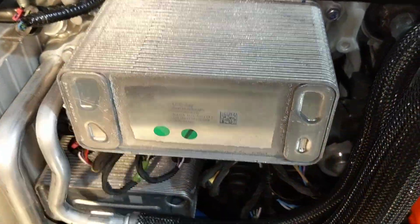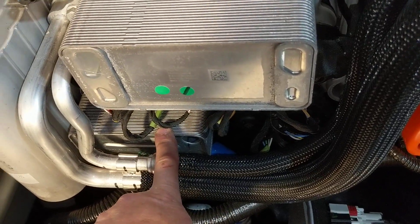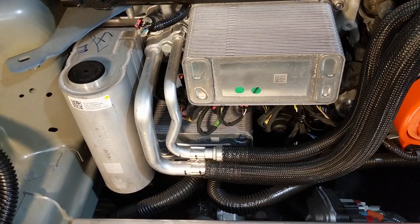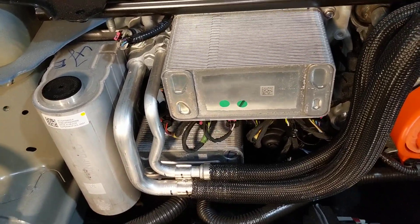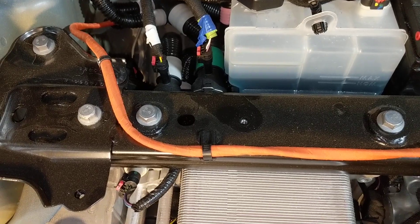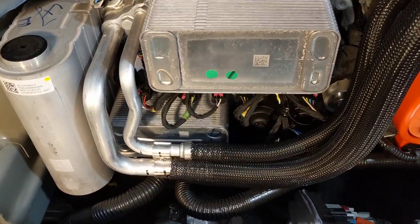There's also a companion to the liquid cooled condenser — a chiller assembly. The Model 3 already had this. This is how they use the air conditioning function of the heat pump to cool the glycol. If they're trying to cool the powertrain or the battery during supercharging, it's highly likely this cooling system could move more heat out of the powertrain and battery. So this newer Model 3 performance might do a lot better on the track. The glycol reservoir back here goes down to what I believe is an octavalve — Tesla has an octopus theme — an eight-port valve with two more ports to switch in the condenser.